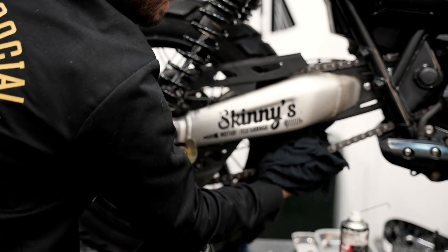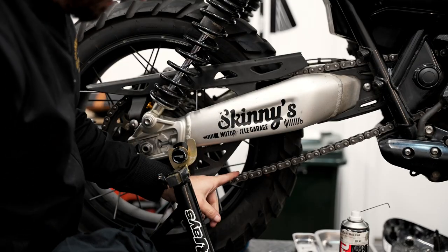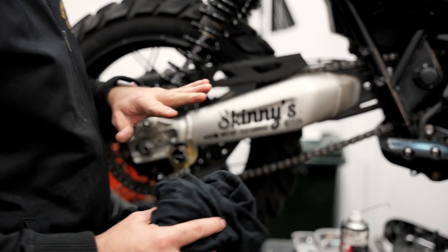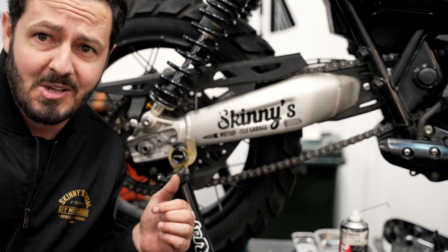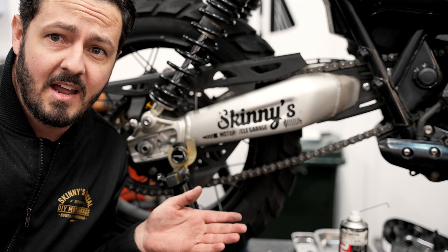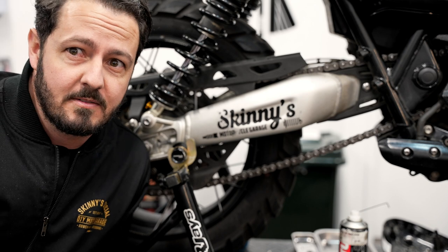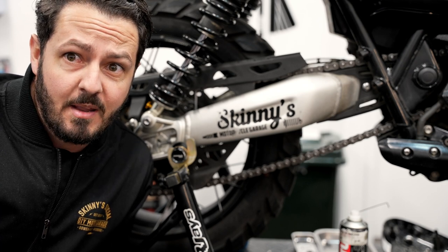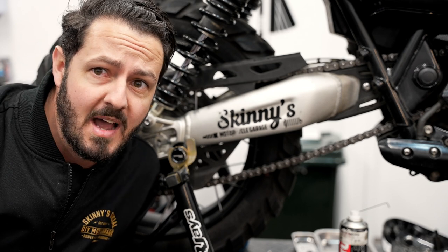One thing to be really careful of is not getting your finger in between the chain and your sprocket. I crunched my finger — we were running a maintenance workshop and I was showing someone on the left-hand side while the chain was on the right-hand side, and I actually pulled my own finger into the sprocket. Felt like my finger had just been smashed into a thousand pieces and ended up losing the fingernail. Not recommended. Also, some people think they're being smart by turning the bike on, putting it in gear with the wheel spinning, and then holding stuff near the chain. Mechanics who had shortened fingers taught me that was a bad idea. Definitely don't do that.